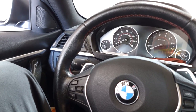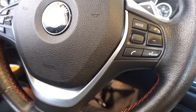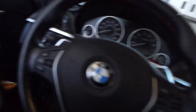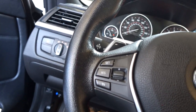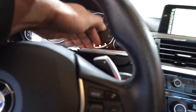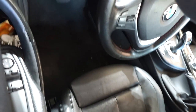I just popped the hood. I've got my scanner — the Autel — over there on that table, and I got my dongle down there. It's Bluetooth wireless, so that's what sends all the data over to the scanner. I also have to let this customer know that the battery voltage on this thing is starting to get low — I can see that data on the scanner.